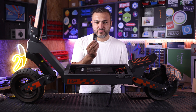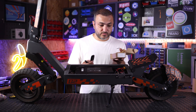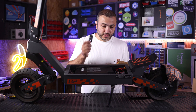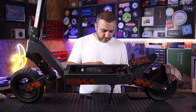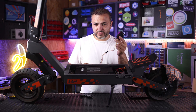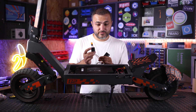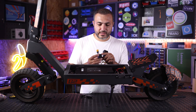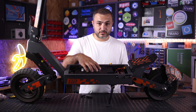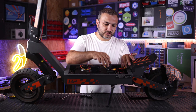I recommend you not press the lightning button, because it will disable the module. To reactivate it you must remove the cover, remove the module, and redo the procedure. In the package you have two remotes, and the alarm system itself is composed of two pieces: the alarm with the siren, and the relay. This relay handles up to 80 amps at a maximum of 68 volts DC — more than enough to power the electric scooter without any problem.